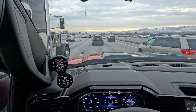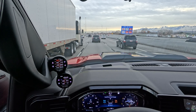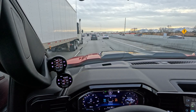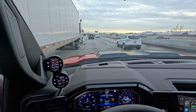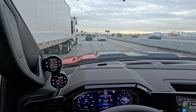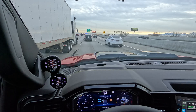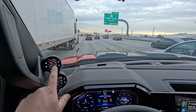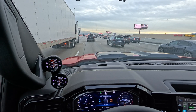Here we are just cruising at 40 plus miles per hour. This is optimal in my opinion because you're just lightly cruising — you're not going to totally kill your fuel mileage. I'm in the 13s with moderate throttle, cruising along in the regen. Soot load is down to 72%. EGT 1 is right after the turbocharger, so you're not going to get too much heat there. It's where the particulate filters are at that EGT 2 and 3 are located.